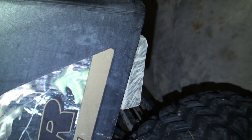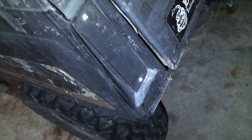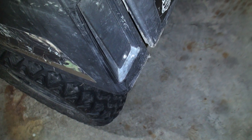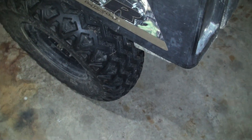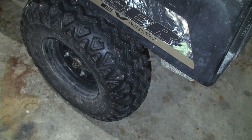This little trailer wire harness is what I ran all my 12-volt lights with. I've got two in the back — a little tight in here. They've actually got a mount under there and they're pointed down, which works a lot better than I expected. When you're backing up you need that light right behind you. But they swivel — I made metal plates with a little bracket on the inside which holds the light. You can't leave them straight down because when you flip the bed up they come up and hit the tire.